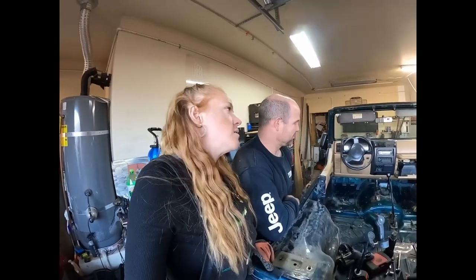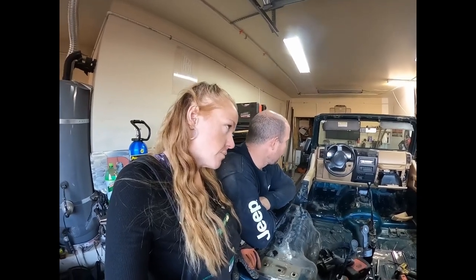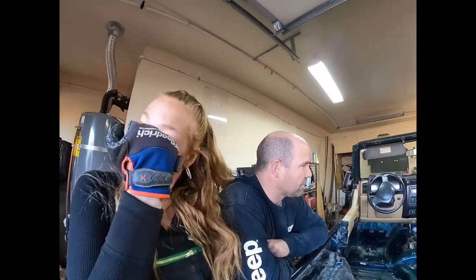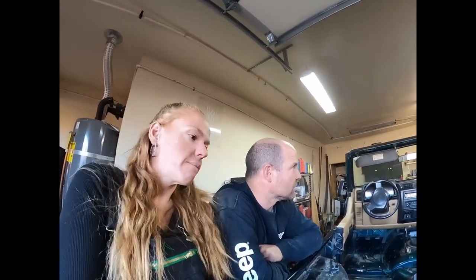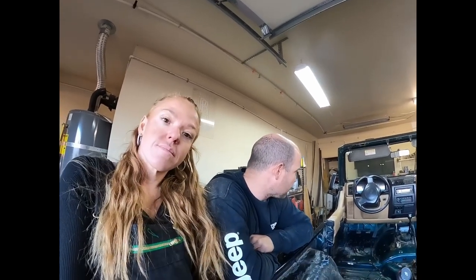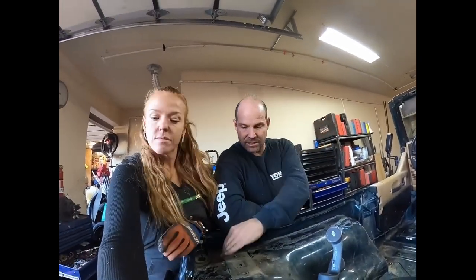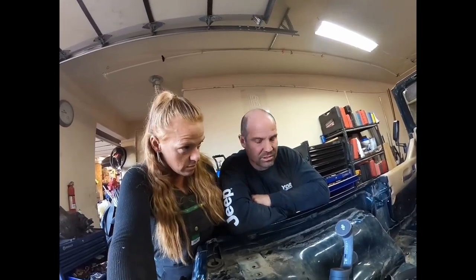Alright, so we're going to go through the dash then? I think we're going to go through the dash. Are we going to have fewer bends if we do it that way? I think we'll have the same amount of bends no matter what. Okay, well, we want to minimize the bends anyway. Yeah, tubing's stronger with the fewest bends. Yes, but we'll have a soft bend and then a 90 and another soft bend here. Then come down to a 90 through the rear.